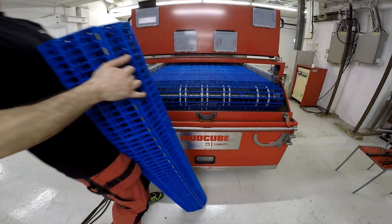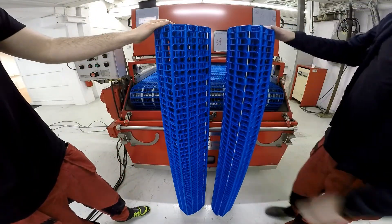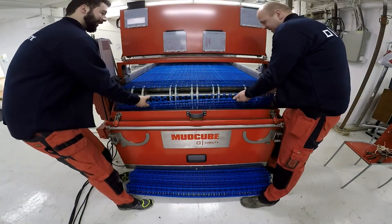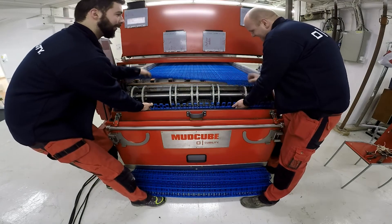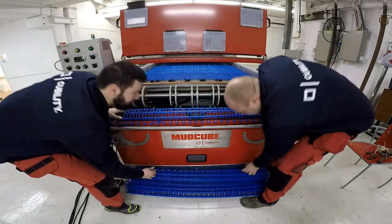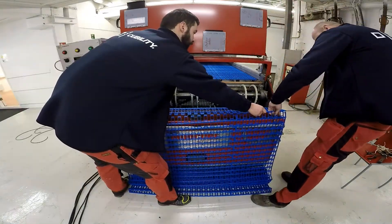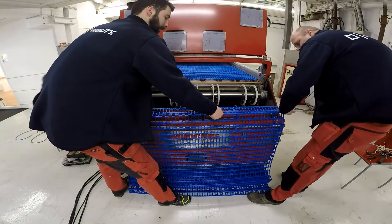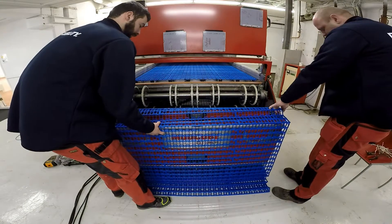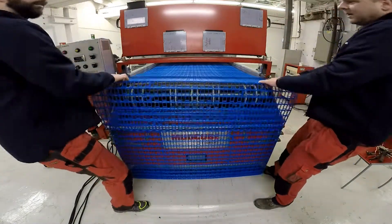So these are the two belts to make up one. First you will attach the half of the new belt onto the old one. It's easiest to feed the new belt in from the bottom upwards. Once you've got the bar in, just feed it in from the bottom and pull it out from the top.